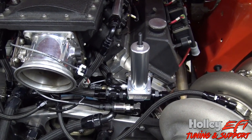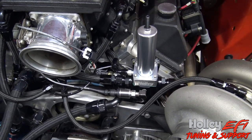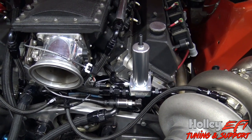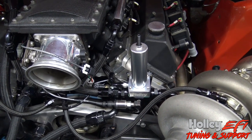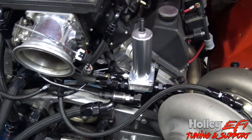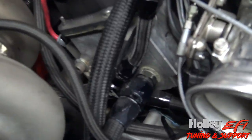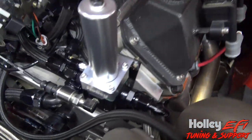We're doing a new installation on this Holley setup and I'll do a couple other videos on how to set things up like flex fuel. You have to run the regulator with the fuel pump. At 18 volts the pump flows right around six to six and a half gallons per minute, so the regulator has to move a good bit of fuel through the return port. We swapped out the old regulator for the new one, modified the bracket a little. It's plumbed from a feed line that feeds the front of the rails, returns off the back of the rails, and feeds back into the regulator.